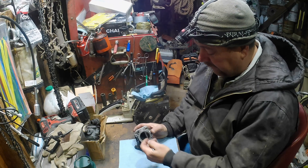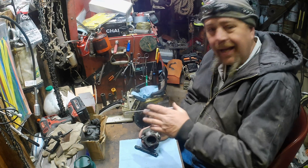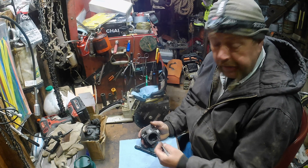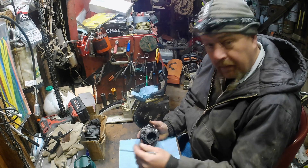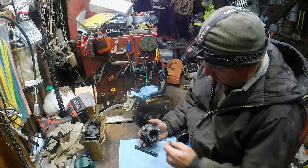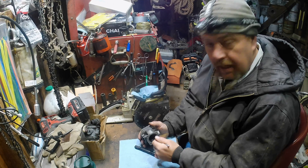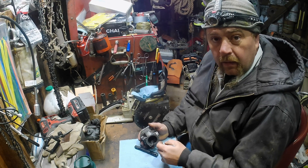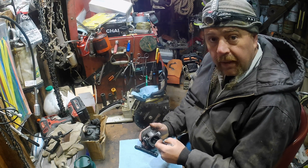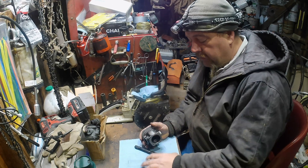It's kind of like a runner sucking air through a straw versus air through his mouth wide open — which can be a good or bad thing. You can get too much air; everything's cause and effect. Too small is like the Three Stooges running down the hall all trying to get through the same door — they all get clogged up, you don't get as much air up on top. Conversely, when the door is just big enough and all three of them run in there, they all fit just fine — they run in and hit the back wall and the door slams after them. That's where your lift comes into play, and that's why people's saws run so different even if they have the same timing numbers.